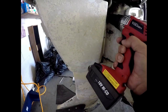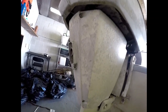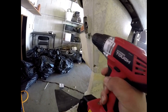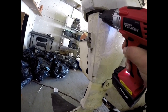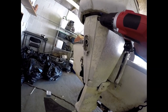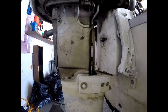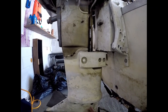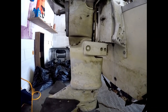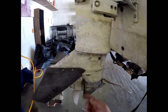There goes a nut — I'll have to remember to pick them up when I'm done. Got a few right here to take out as well. I'm not really worried about these nuts because they're replaceable, you can find them at any hardware store. Now I've got this all loose here. The linkage — I did not take it off because a lot of people get away without having to take it off. I've got it loosened up to where when I pull this down it's going to be in the slack for the rod to come down, pull the pin out, and take this lower unit off. Anything to make your job easier — it's best to go easy.